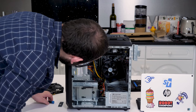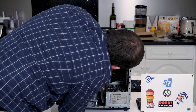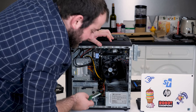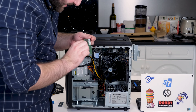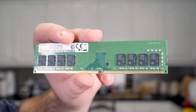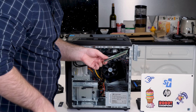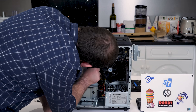Let's pull out one of the RAM sticks. For all the expandability in this case, the one thing it doesn't have many of is RAM slots — it has just two. This is rated at 2666 MHz, and these are two 8GB sticks made by Samsung no less. So they'll be of reasonable quality — nothing visually thrilling, but it is standard RAM. That's the only real limiting factor for future upgradability looking at this motherboard.